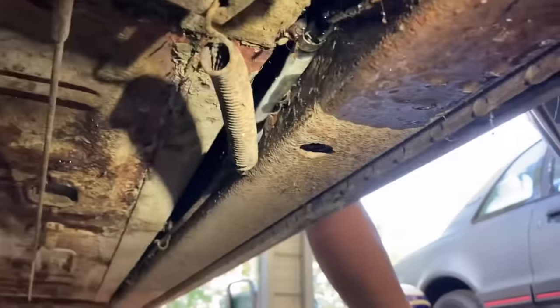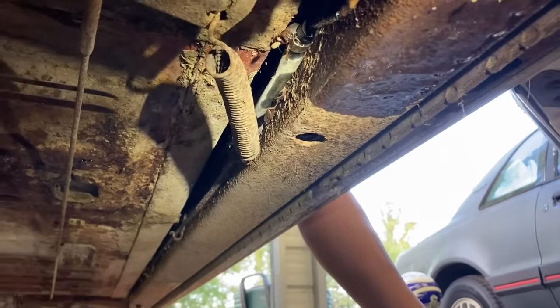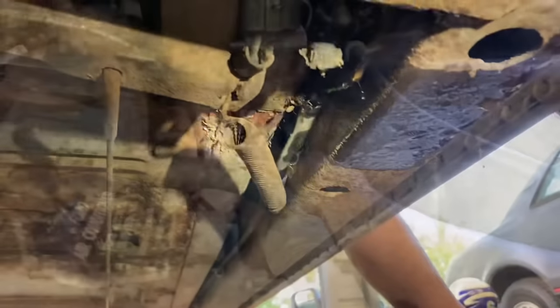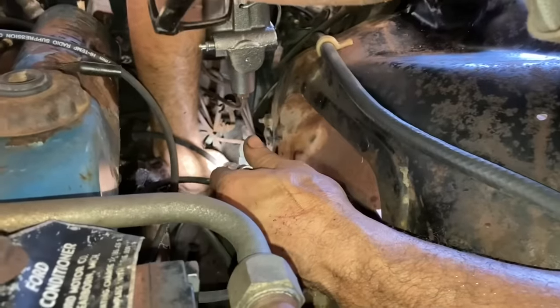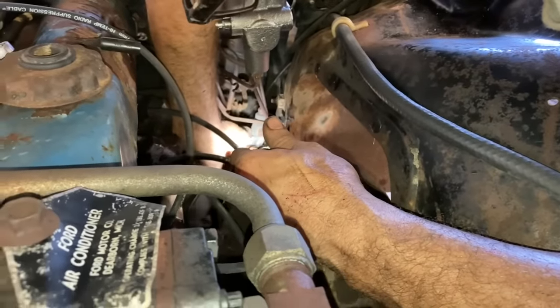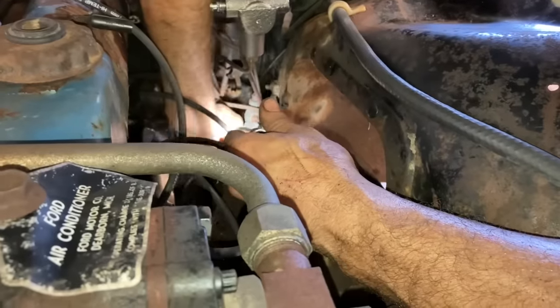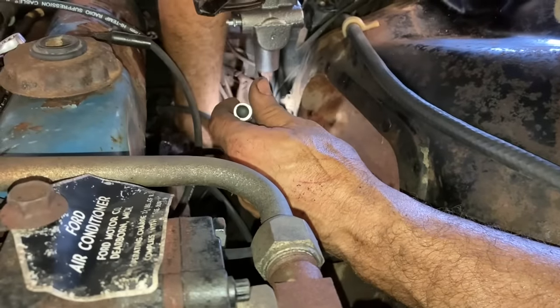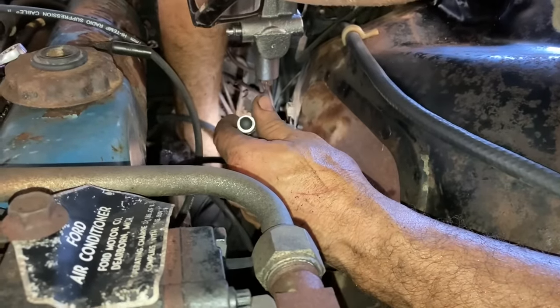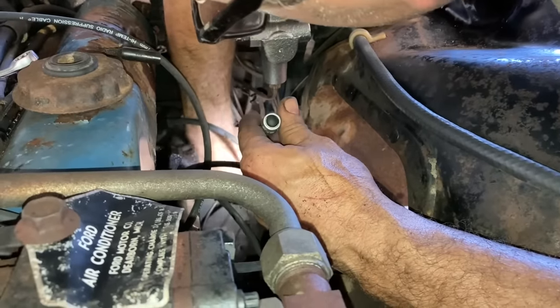Okay. Somebody put a rubber hose over the brake line trying to fix it. Okay, I've got to remake the rear brake line. Wonderful news. So this line goes in the back of the proportioning valve here. And it was more stuck than my old Power Wagon. So I had to heat it up with a torch, and we just finally got it broke loose here. Took a tractor to get the Power Wagon out back in the day.